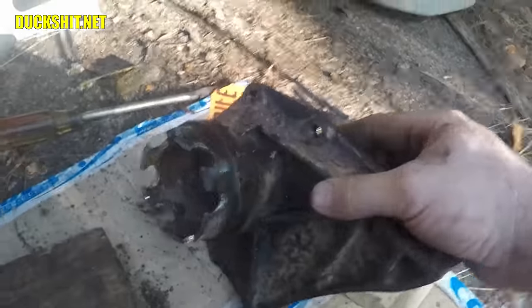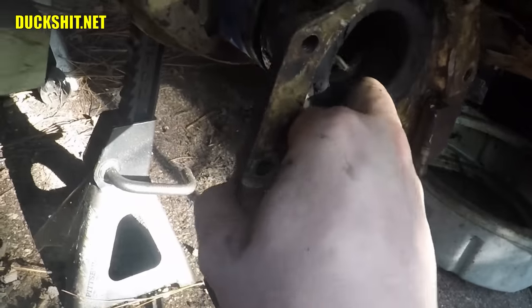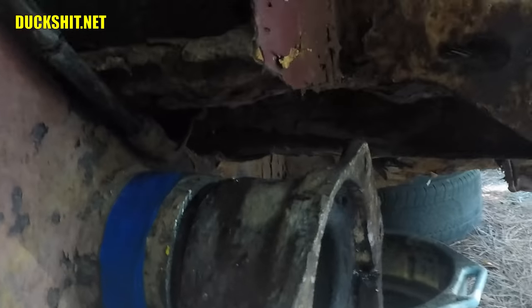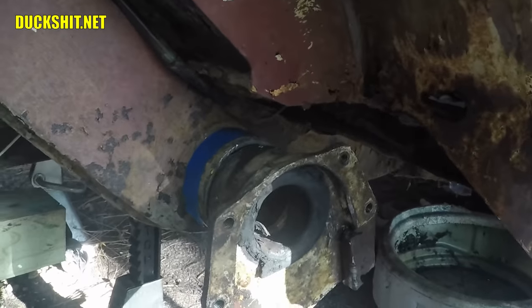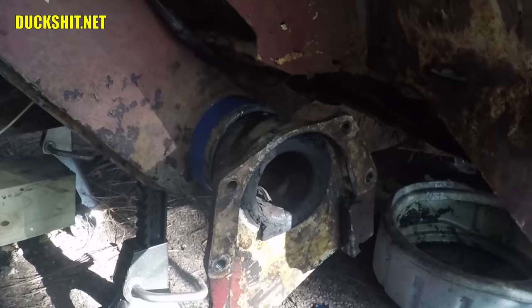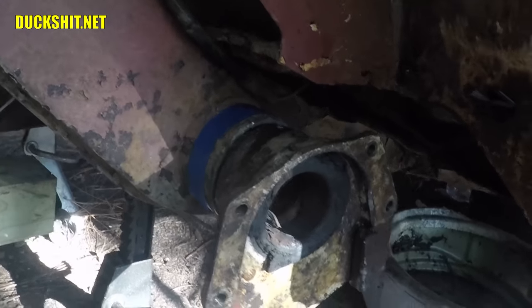There's my end casting. Next time I do the other side I'm going to do this quite differently now that I've had one done - I've got a little learning experience here. It still has the tube left on it which means it should slot right into that hole. And yeah, it does slot right into that hole with no problem. You can see I've got that blue tape marking - I'm going to cut off another half inch here. The goal is to get the torsion tube even with the side of the body so I can run a straight edge up and down this without a gap. I don't want to go any further than that; it should narrow the rear end about an inch and a half.